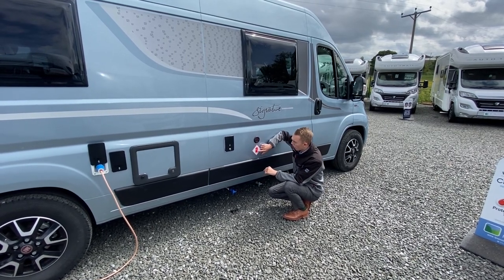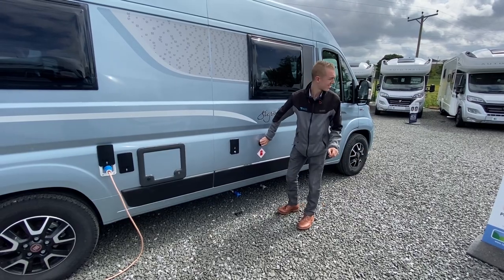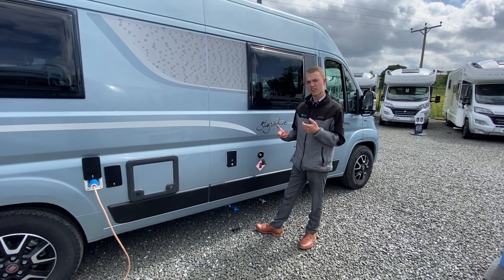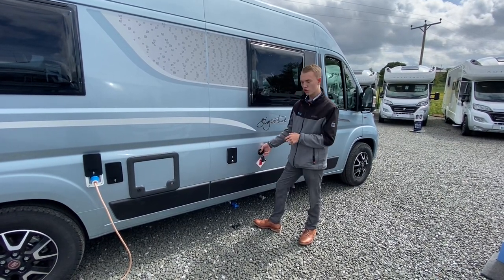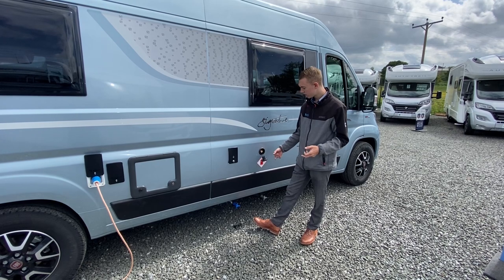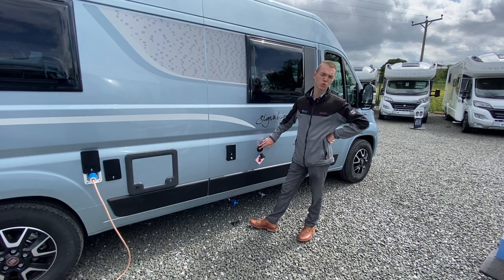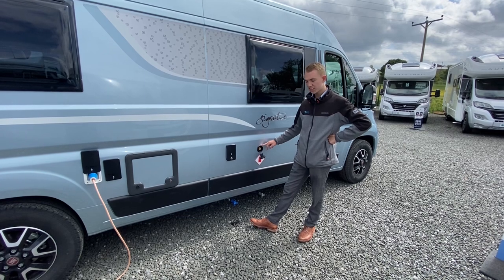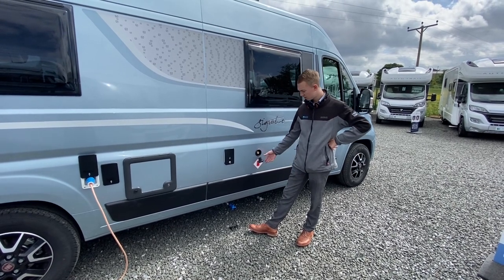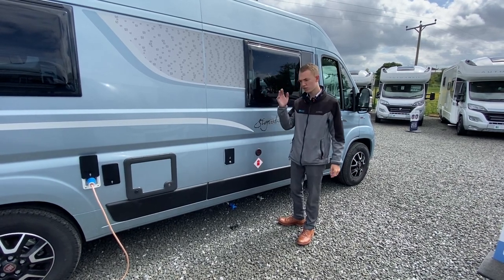This is your LPG — liquid petroleum gas. In here it's got a 25-litre underslung gas tank directly underneath the chassis. To fill it up, it's a ACME fitting — you put the gun into the van and turn the front end to connect onto the fitting here, then lift the lever and push the pump button until it doesn't go up anymore, meaning it's full. It takes about £15 to fill a 25-litre underslung gas tank. Inside the vehicle beside the control panel there is a green-to-red marker light showing the level.